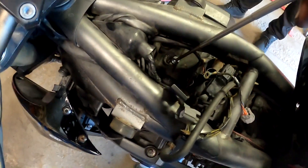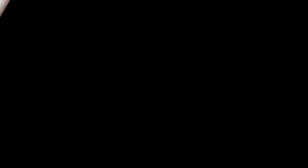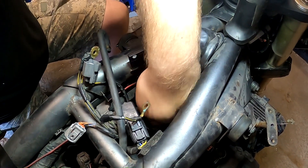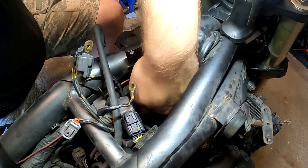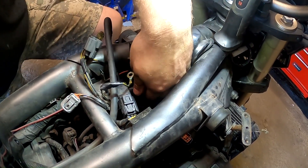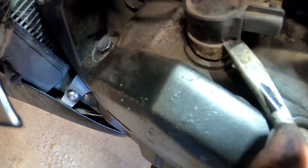Use a longer socket in order to take out the spark plug. Used this magnetic tool — as you can see, the old spark plug is over here. Turn it, and it came loose. Try to get this coil out — yes, there are cables everywhere, it's a bit tricky. Old Soviet-era screwdriver — and it came out nicely.